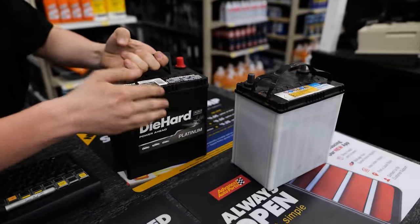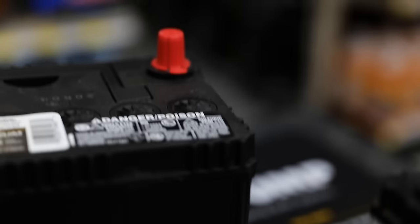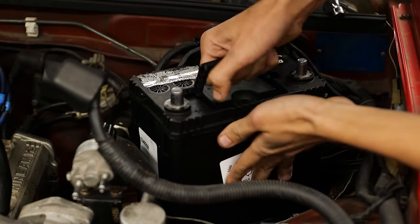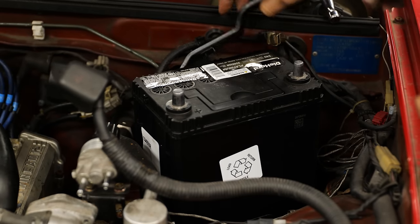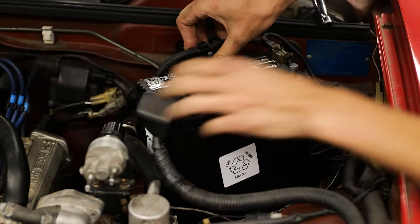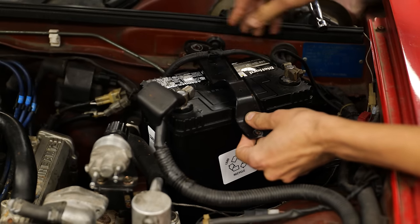The battery in question is from a 2007 Toyota Prius, but I think most model years should work. I've also heard that the Honda Fit battery works, and it's probably cheaper. The Prius battery is maybe half an inch longer than the battery that comes with the Cappuccino, but it still fits pretty much perfectly. And most importantly, the terminals and posts are exactly the right size.